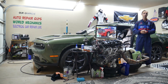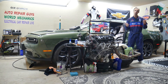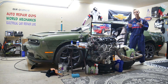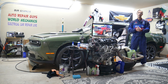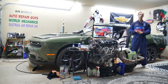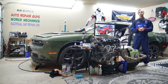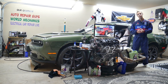Another thing that could cause the traction control light to be on is the steering angle sensor. Sometimes it's actually bad, but most of the time you may just need to reset or calibrate it. You need to do that every time after a suspension replacement. Even a weak battery or battery replacement may require it. After a steering angle sensor replacement, you also need to reset and calibrate it. Hopefully this video is helpful — thank you for watching, see you next time.